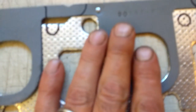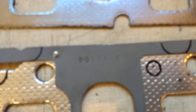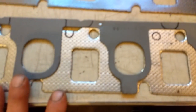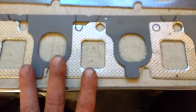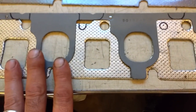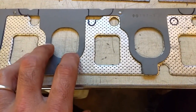Some part numbers I wanted to show you. This is a carbureted intake and exhaust manifold combination gasket — it's a favorite of mine for carbureted use. This particular gasket has held up to 20 PSI and 37 pounds of back pressure on a turbo application with no sealer whatsoever. Definitely a favorite and I've had no trouble with that.